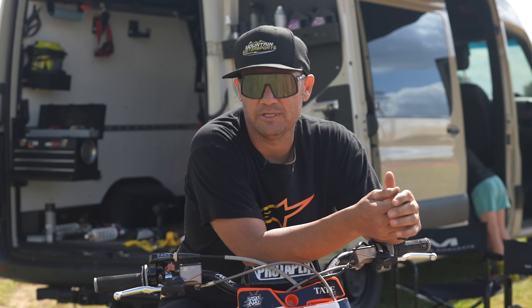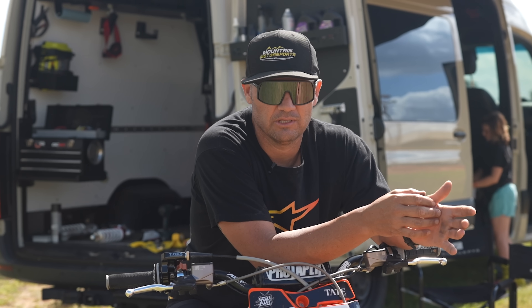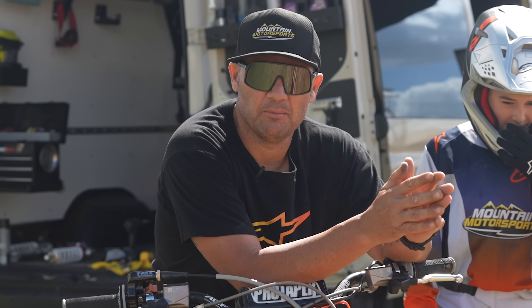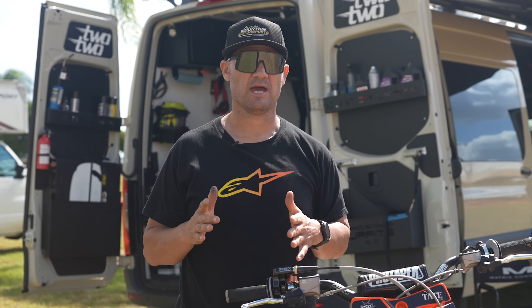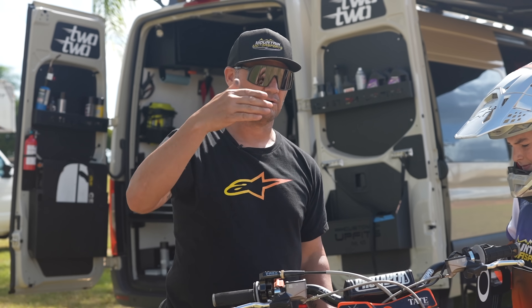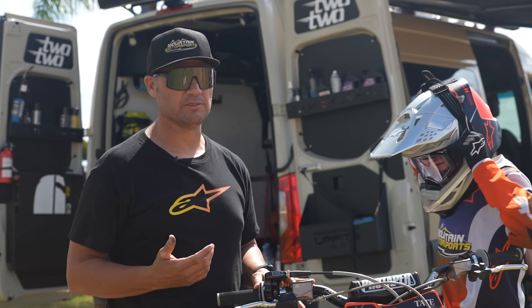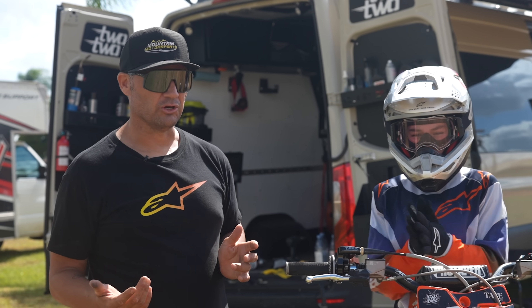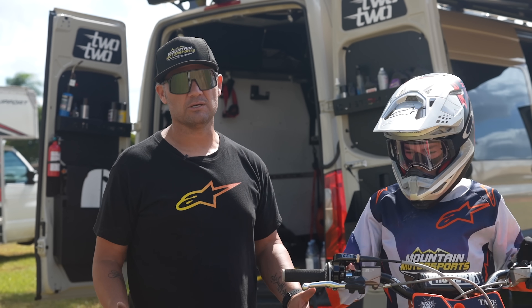The whole idea of testing is that you're trying to better the bike. You can't necessarily always set the bike up for the turns and then give it up in the whoops — there are certain things you chase. Early days the bike had a bigger window and a bigger balance opportunity, so you could set it up for everything. Now the bikes are very focused on centralized mass, getting it low, so the bike wants to move front to rear a lot more. Now you almost have to have multiple setups — one where the bike's really good in the turns if the whoops are small, and another where you can give a little in the turns because the whoops are really big. It's always hard to get everything better.